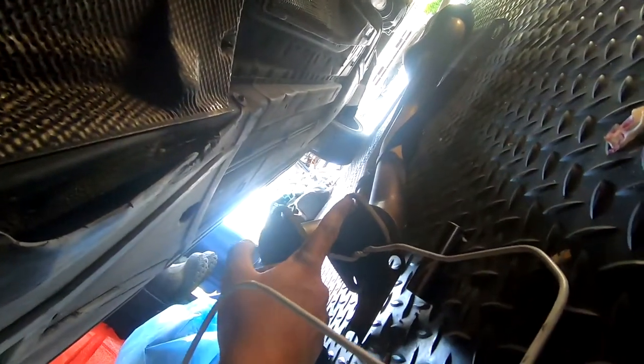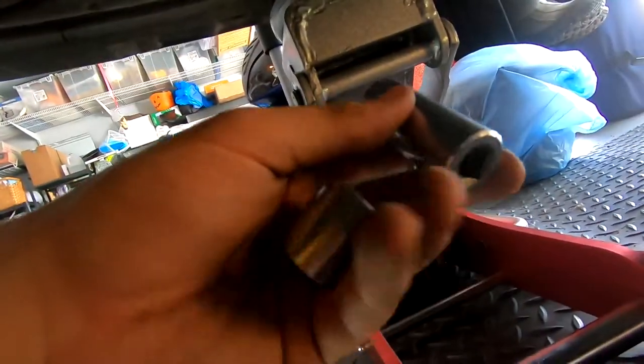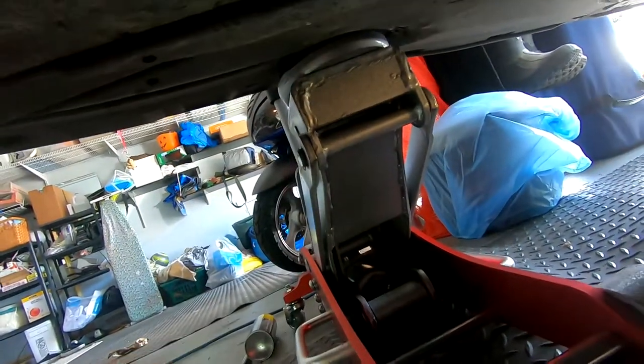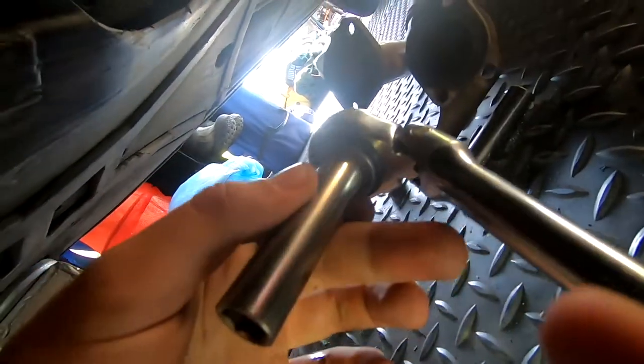Anyways, here in these holes and these bolts, this is the only spot in my car, which is a 2000 520i, that they detach, which is right next to the cats. You're gonna want to have a 5/8 or a 17 millimeter socket for these. They're gonna be on here with the exhaust coming out right here. Put a lot of WD-40 on there and it should come out. They're fairly simple to get out. Just make sure you have one of these sockets or wrenches that you can bend, so you can reach into other places.